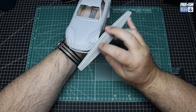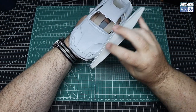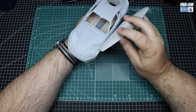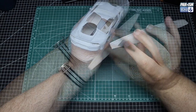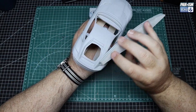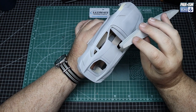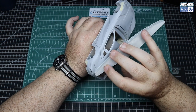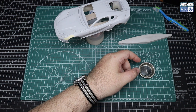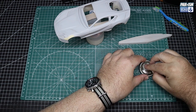Now, this is dry. This has been dry now for a good 6 hours. It's the same day. And I've got my UMP 240 sponge sander, and I'm just getting rid of a few flaws in the resin. So it's nothing major. It's just a few wispy bits of resin on the body. So might as well take this opportunity while the primer is off gassing, just to make sure we've got a perfectly smooth body. Because we're not going to 2K this, we've got no leeway on flaws in that body at all. So well worth taking the time here. So all the flaws gone there.